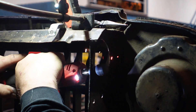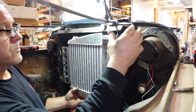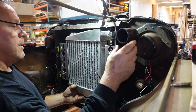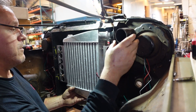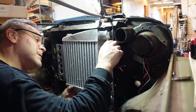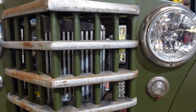Now we want to fit the intercooler back in now that we have the lights on, to see if we have to trim anything for clearance. We're running two-inch intercooler tube — this is the smallest tube size we could find, stepped down to two inch. The inlet hose, top and bottom, is two inch and it's really tight making a turn up against the headlight bucket, which is why we have rubber in there. We've got 20 pounds of stuff in a 10-pound bag as usual — we still have to get the trans cooler on the front and we have the lights up here, but first we need to get the intercooler positioned correctly up and down. Here's what it looks like with the intercooler and lights on.